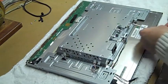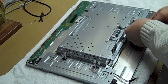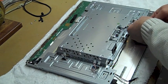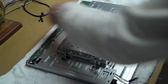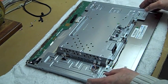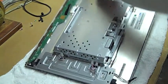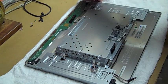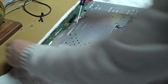Set those aside. Then you need to take off the nuts for the VGA adapter — that's a three-sixteenths socket, or you can just use a pair of needle-nose pliers. Once you get those disconnected, the next thing is four screws — one or two on each end — holding the bracket assembly together. Take out those four screws, one more screw.